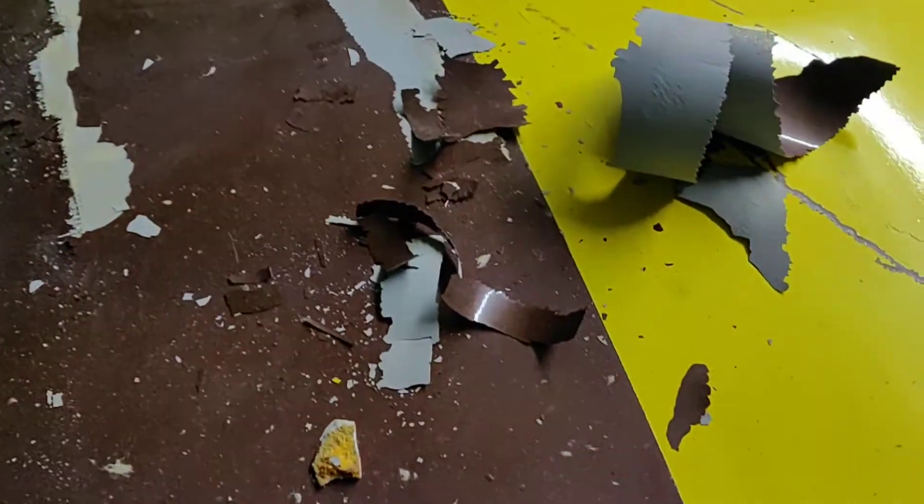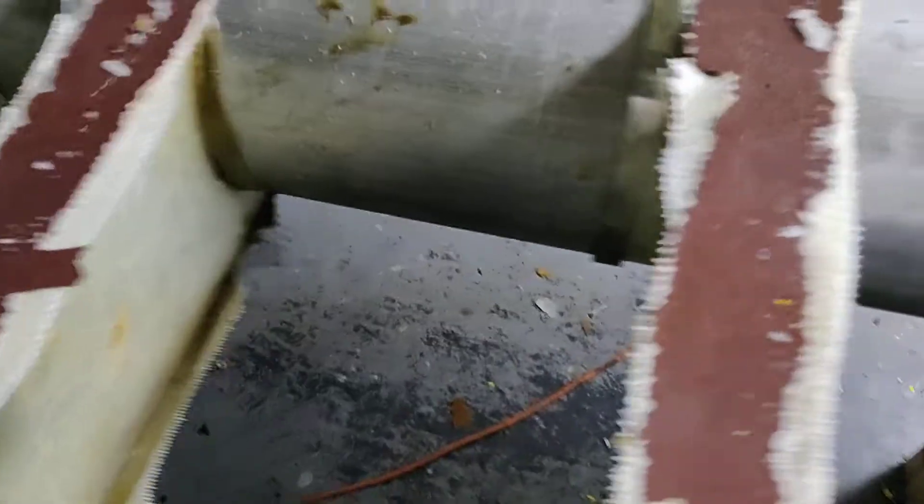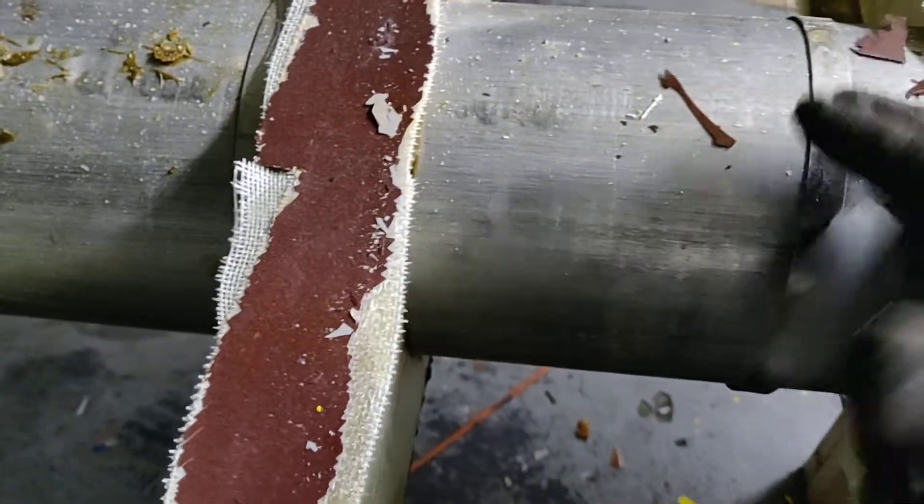And you can see the paint comes off. Evidently this gray stuff here was a filler — it doesn't look like primer, it looks like they were filling it in. Chunks of paint — you can see the paint just separates right off of it. So I have no idea, we're guessing UV, maybe just pure age. But gasoline should not have been on this side — this is not the wet wing. All the fuel cell stuff is over there. You can see there's no pro seal, nothing on this edge.